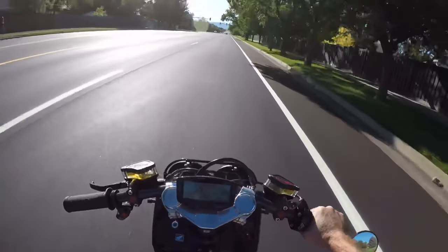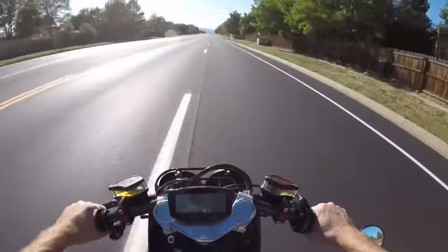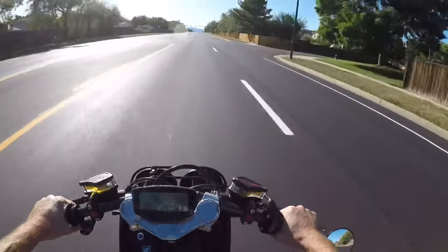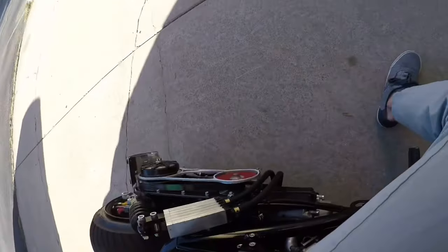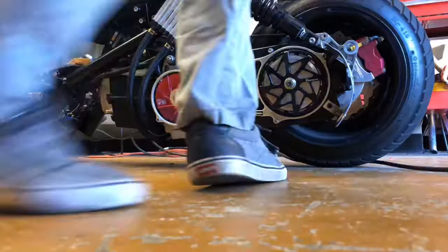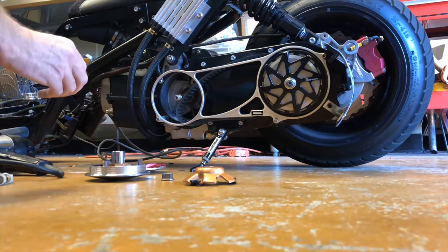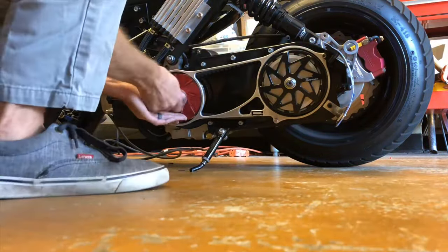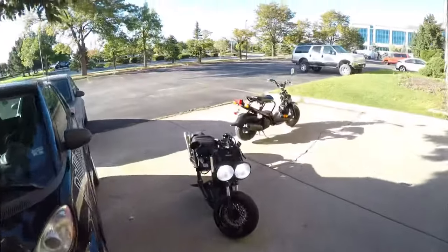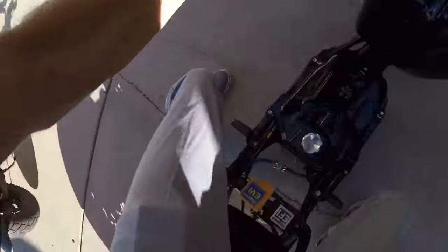In my hands, my feet, and my butt — there's not as much engine vibration. That's my favorite thing about the clutch so far. Going 50 and I nail it — you can feel the grab with the old clutch that wouldn't happen. Now that this thing is hotter than the flames of hell, let's pull it apart and put some 12 gram sliders in there and see what happens. Big difference. Let's try this thing with 12 gram sliders — I feel like they're going to be too light.